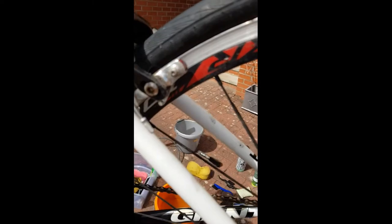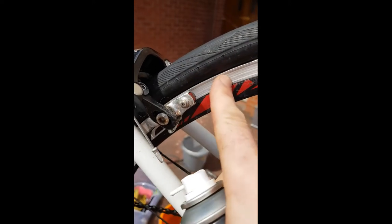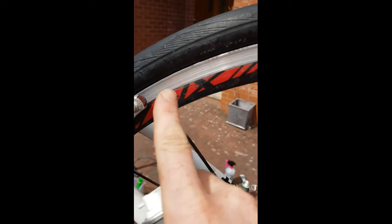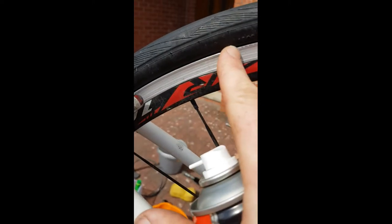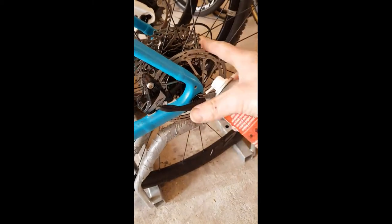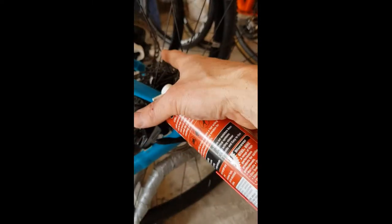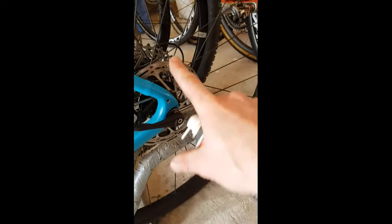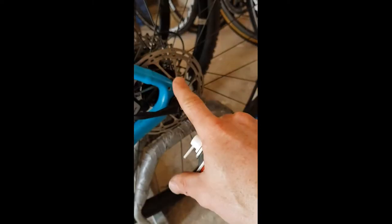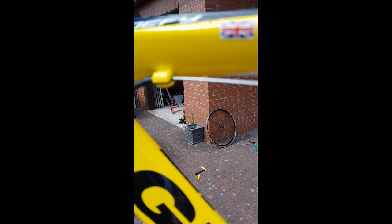Just be careful when spraying any sort of oil or lubricant — if you've got rim brakes where the rubber touches the wheel to stop you, don't get any on that rim, because that's where the rubber is stopping you. Some of you may have disc brakes where it doesn't touch the wheel. Either way, when you're spraying near the cassette at the back, be careful not to get oil on the brake surfaces. If you think you have, get that old dish towel and wipe it off as quickly as possible.